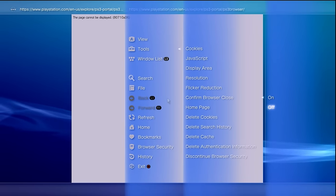Once everything shows up properly, hit OK, come back up to the system manager tab and wait for it to load in. Once the system manager comes up, go to the flash memory option, tap X, and there's only going to be one option: save flash memory backup. Navigate down to this option, tap X, and you should see your USB drive here. Tap on your USB drive, tap save, and it's now going to begin transferring the flash backup. This could be a few hundred megabytes or only about 16 megabytes depending on your flash storage type. Once done, click close and close out of your browser, then unplug the USB drive and take it to your computer.